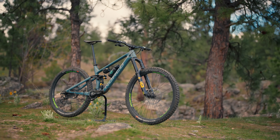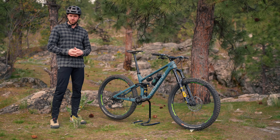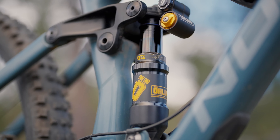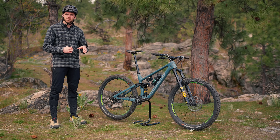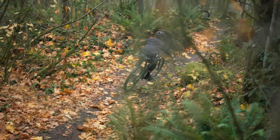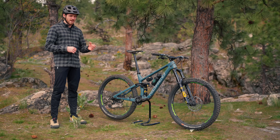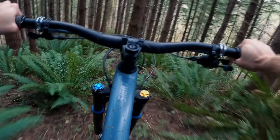Now let's move to the back of the bike — we have the TTX2 Air shock. This is a 150mm travel with a 52.5mm stroke shock on this Norco Sight. The shock has a three-position high-speed compression lever with a climb or lockout mode. The lockout is a little softer than most, giving you some sensitivity on climbs to get over roots. For me it pretty much lived in the open setting — I mentioned using the middle setting on some extreme flow trails with no bumps, but I've used that maybe three times. For air pressure I'm running between 190 and 200 PSI depending on the trails.